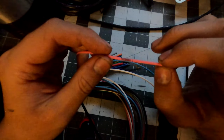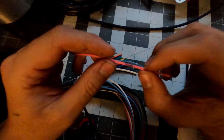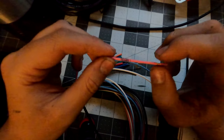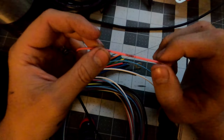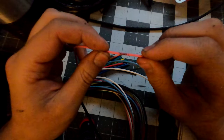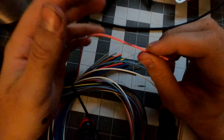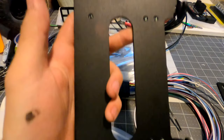The pink wire is your second trigger wire. Whatever switches you have hooked up to this trigger wire will all be actuated at once when you perform an action. For example, when you turn your high beams on, you want your roof rack light bar to turn on at the same time. As soon as you turn the high beams on, it sends a signal through this trigger wire and says 'turn these two switches on,' activating whatever lights you have hooked up.